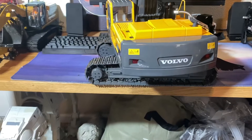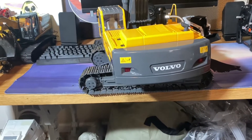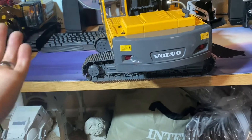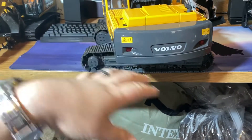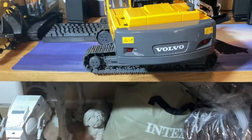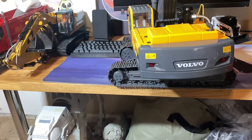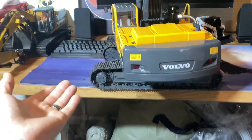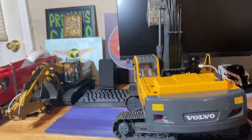When you're done, please use a toothbrush or a little air blower. Do not use water. Guys will sit there and try to spray these with water — that is the silliest thing. Not anything bad against Sparks Studios, but he actually washed his — it's the earlier generation, the 4200X. He washed it, there was a little water in there, it burned his ESC and the motor didn't act right — he had to replace the motor and ESC. It takes just a little bit of water to ruin something. So don't use water.